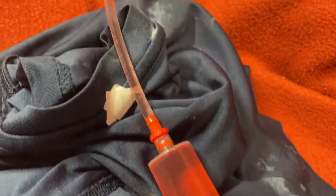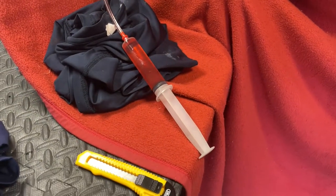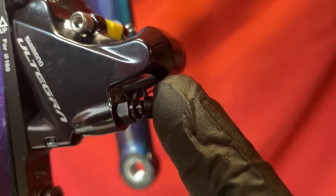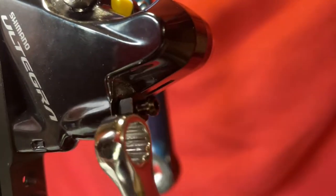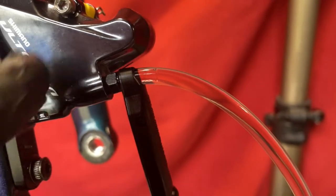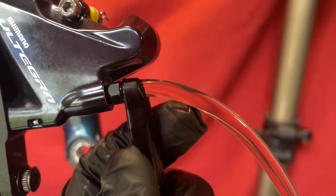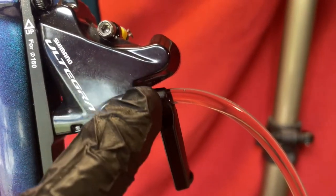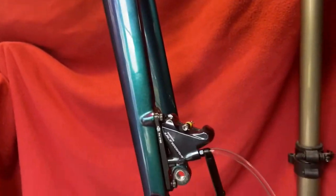So we've drawn up our syringe full of mineral oil. Now we're just going to set the brake. You need to take this bleed cap off of the port — I've just taken it completely off. The syringe is set up, it's on the bleed pot. This little plastic clip comes over the top just to hold it so it doesn't fall off. I've opened up the valve and then basically just pushed the fluid through up into the handlebar.